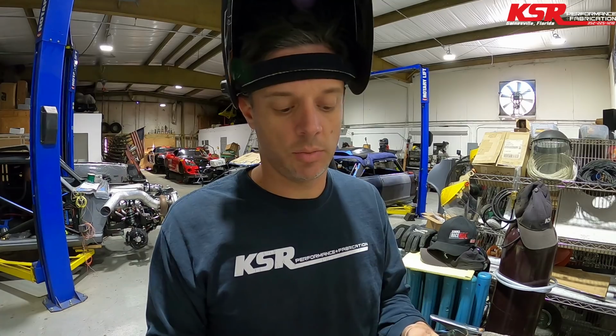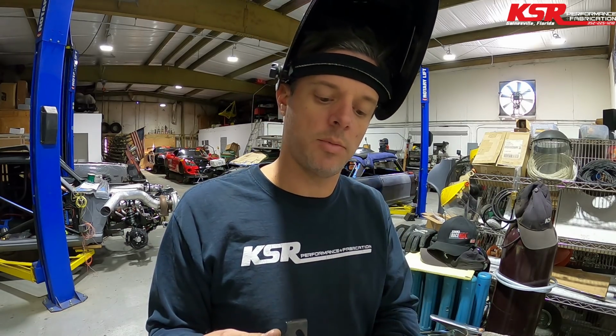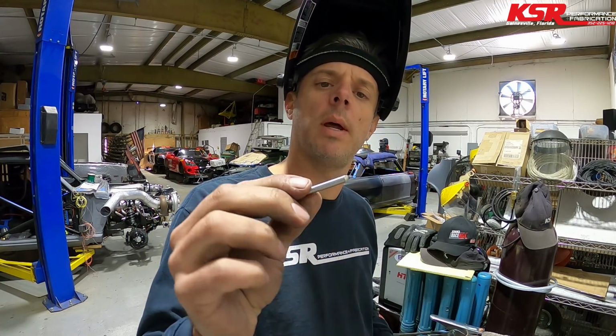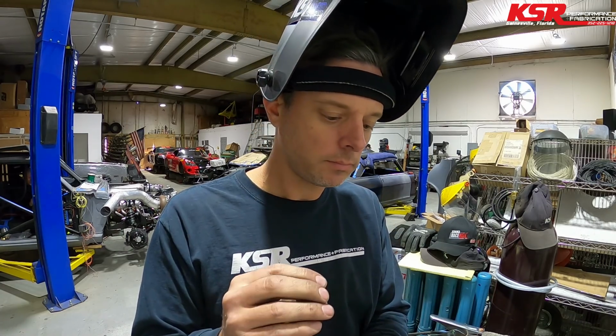So I take just one quick way that I can do. I just take the factory cover for the cam sensor, pop it off. Got me a little pointer that I machined. I mean, you can do this with a belt sander. You just chuck this in a drill and hold it at an angle and get a nice little point on it. And I've marked where top dead center is on here, and this will tweak just a little bit.